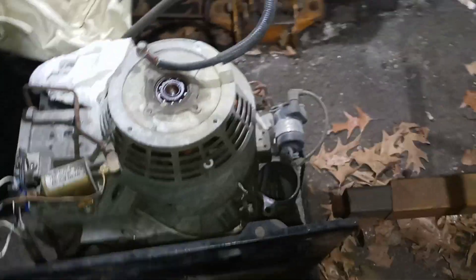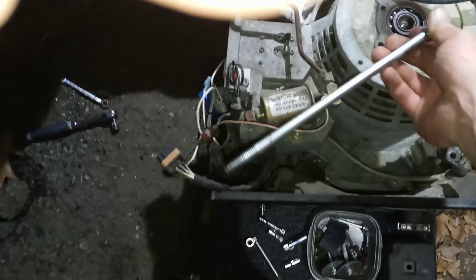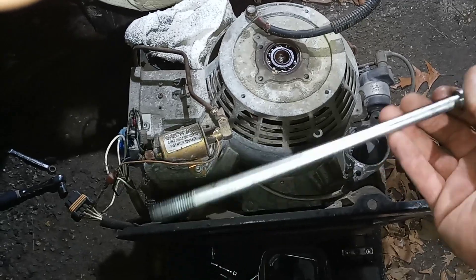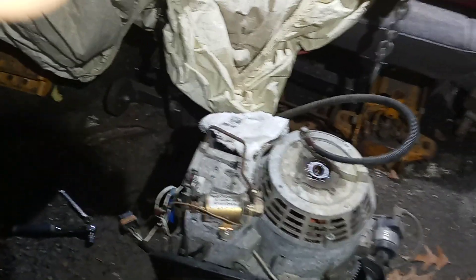This is usually sitting mounted in the RV, so this has been quite the pain. I had to pull the starter off to lock up the flywheel and pull this bolt out — I'm not too sure what it does, but it somehow bolts all this stuff together. That bolt doesn't really hit the bearing, so I understand why the bearing can't just be pulled out from this side.